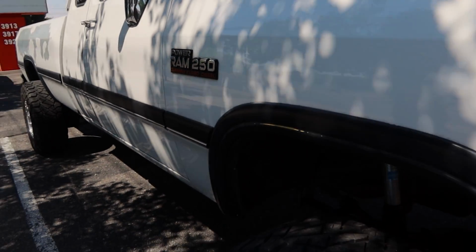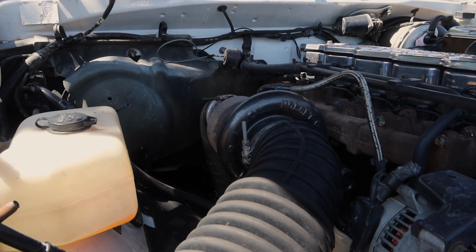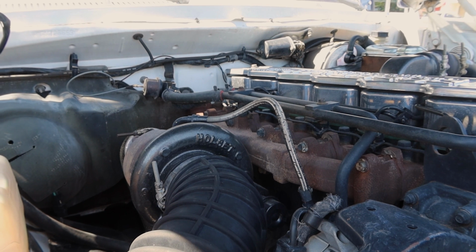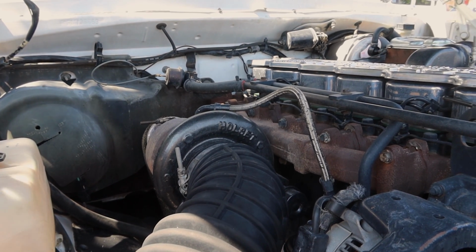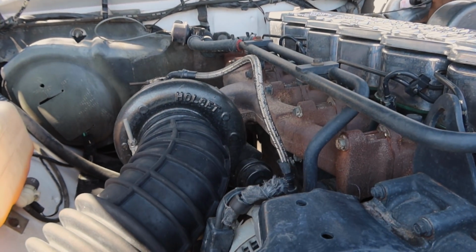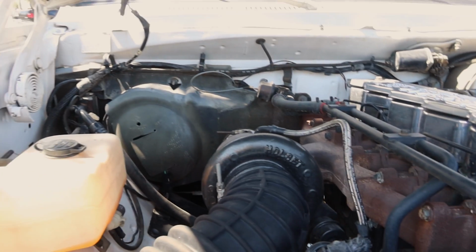I'll be very happy. And as far as the HX35, everybody's always asked me about it, stock for stock, swapping from an H1C, what's your opinion on it? Because I never had a fully factory truck with stock injectors with the HX35, so I'd like to shed some light on that. So I had a 16 centimeter housing on the factory H1C, and that woke it up a lot. I picked up this HX35 for $200 off Marketplace, and I didn't notice a huge difference other than sound. Truthfully, it pulls pretty much the same. It didn't seem like it choked out by any means. No, I don't think it's got enough fuel to choke out or anything. For the overall investment, I'd say the $200 is well worth it, just because they sound way cooler than H1Cs. Yeah, they don't do the sneeze at the end.